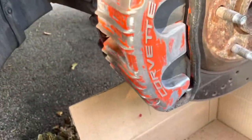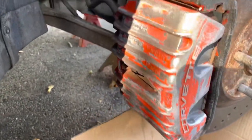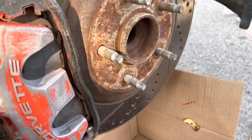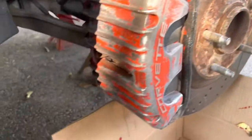Alright guys, so I brake cleaned it a few times. I sanded the fronts down with 60 grit sandpaper and wiped off all the loose paint. The smoother the surface the better this is going to work out. We're going to tape this up and get to painting. A little bit of a crossover video here — we're also going to install the front lip, so stay tuned.